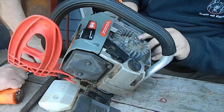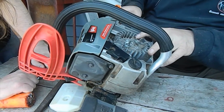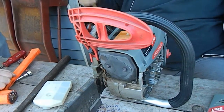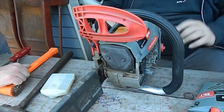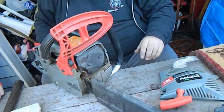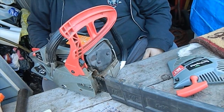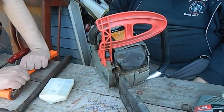We took some compressed air and blew everything out — all the chips and sawdust — behind the flywheel, to make sure there wasn't something else left in there sticking and holding it up. I checked the flywheel; just that one tooth is chipped. There doesn't seem to be any cracks or anything else. It's a drag having it broke, but I'm going to fire it up and see what goes on. It should be just fine — I've had many with similar things and they run forever. We're going to pull off the other cowl, look inside for dirt and sawdust, clean it all out real good, then put this thing back together, pull it a few times and check for spark. There's some old gas in here — it smells awful — so we'll pull this gas out, put fresh gas in, and if it stays free we'll give it a couple of rips and see if we get it going.